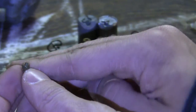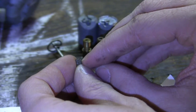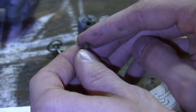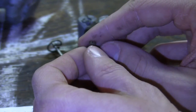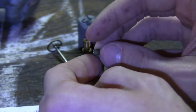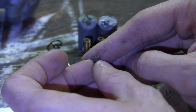First, let's take a look at the main jet. This is probably the easiest to explain. What we have here is a main jet — this is a size 60. As the size gets larger, so does the hole in the middle of it. I pulled this out of one of my stock carburetors. This controls the amount of fuel you're getting when you're at wide open throttle — that's what range this tunes for. However, to an extent, the atomizer and needle can also play a role in that. This goes back to when you're just throwing a cheap pipe on a moped and you're told to up-jet, and you do, and life is great.